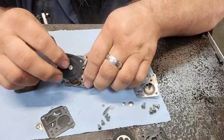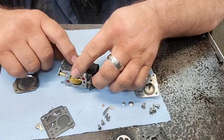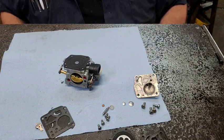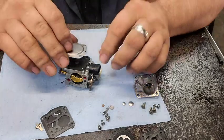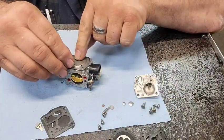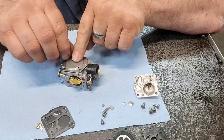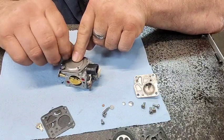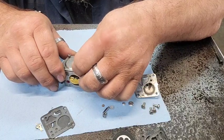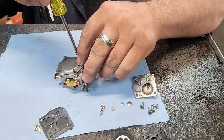What I always do is the simplest and most basic on these things first. You've got to hook that little tab up under there. I've had people ask me why I didn't change the Welch plugs and all that. Here's the reason — if they're good, you're best off just leaving them alone, because you might not make them better if you take them out. So anytime you're doing a carburetor kit, just leave the Welch plugs alone if they look good and they don't seem to be leaking. Do your kit, put it on there and try it. If it runs good, go with it. If you have tunability issues, then just go back in and change the Welch plugs and check your needle height and all that stuff.